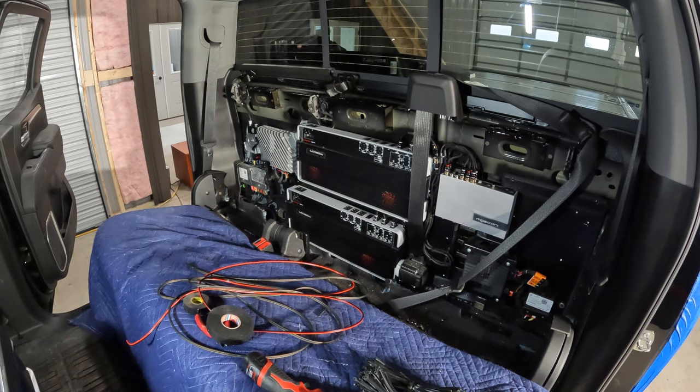the way we did these is, we have one amplifier for the left side of the vehicle, which would be that side, I guess. One amplifier for the right side of the vehicle. So we'll talk about that first, and then we'll tell you where the changes were. But the way this is set up is we bridged a pair of channels for the mid-bass drivers. So if I'm not mistaken, that gave us roughly 290 watts to the Utopia 8s in the front doors.